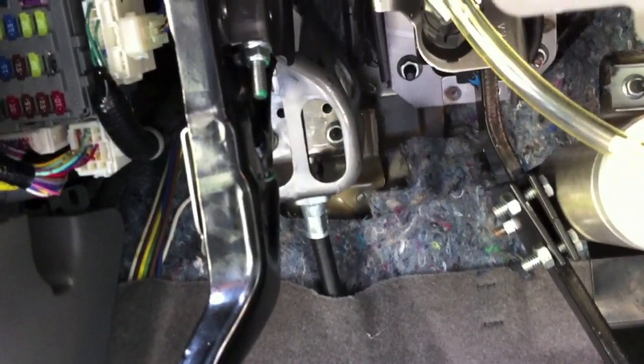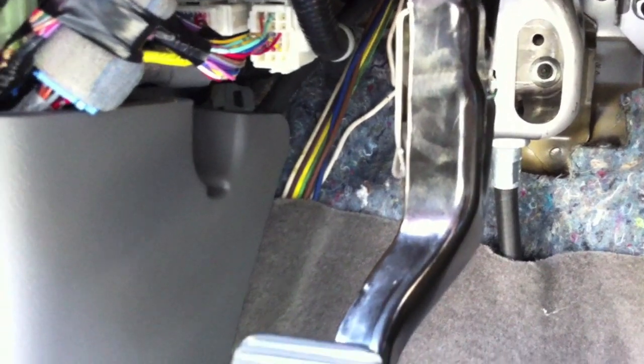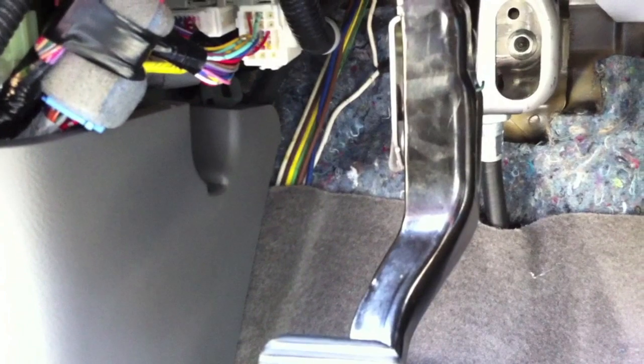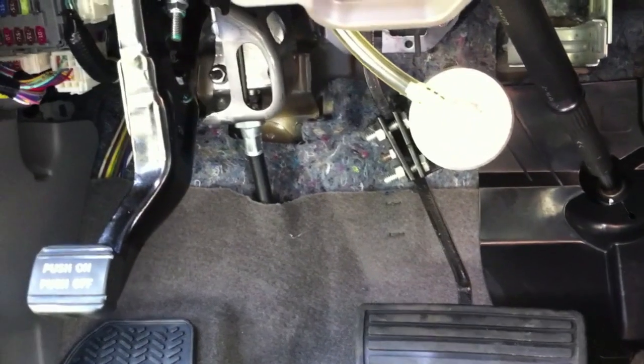Under the dash of most cars, there's a large grommet where the main electrical wiring that we saw under the sill plates goes through to the engine compartment. You can see here where we have installed the wiring for our brake system as well as the tow vehicle wiring through that grommet. What we recommend is you take an X-Acto knife and very carefully cut a slit, making sure there are no wires in that area. The grommet is usually about three times as big as the wire loom. Then take a coat hanger from the engine compartment and feed it through to pull that wiring through — put a loop on it, tape it up, and put some silicone if you're concerned it might get caught, then just pull it all through.